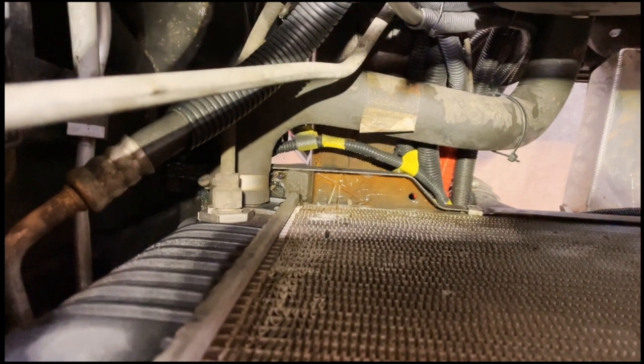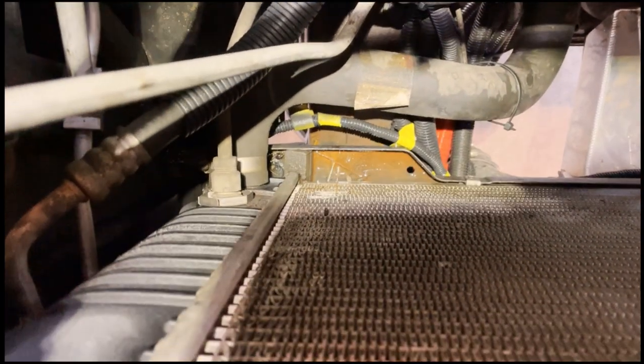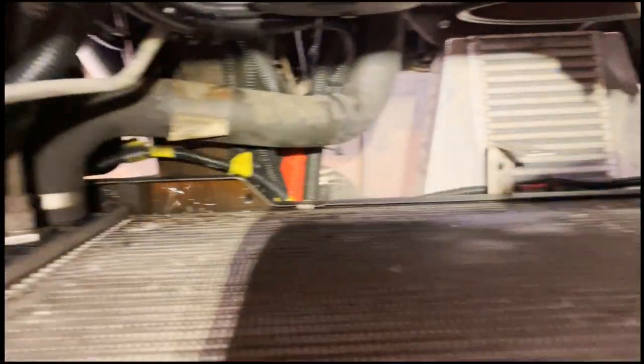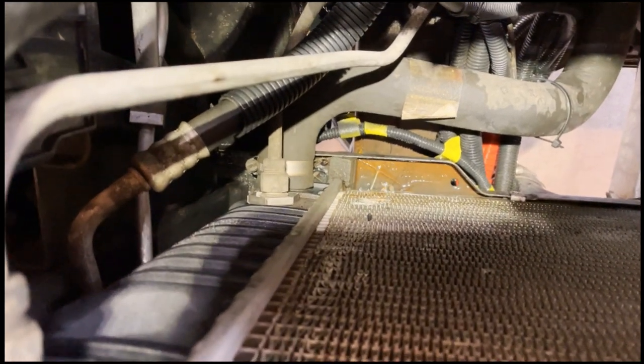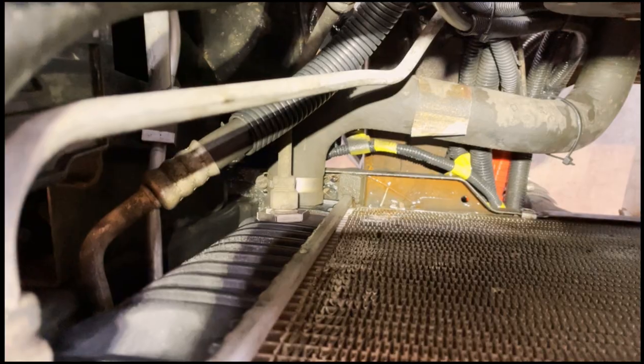That confirms it. The fan was making contact - I thought I built it not to, so I guess I've got to put a gasket in there. It's leaking out right there, and right where my brackets are I've got wear spots too, but I think this is it. That's the hole that's killing me. So a new radiator, addressed with a gasket, will fix this.